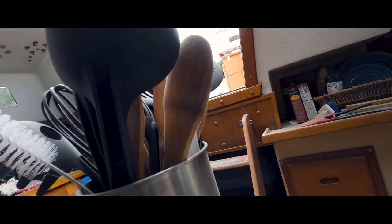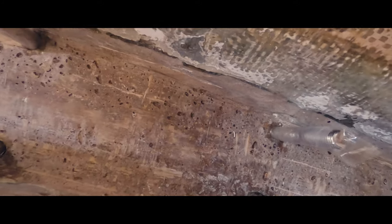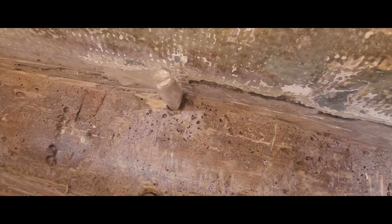We're going to fit all the fiberglass into place, make sure that each layer is tailored to where we need it to be. And then we're going to remove it all back out again. The first thing that I'm going to do is fair out and fill in any of the little crevices and holes that we wouldn't want to stay behind the glass. All the little air bubble pockets down below need to be filled in.